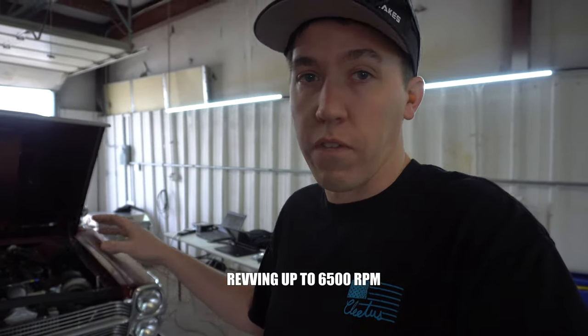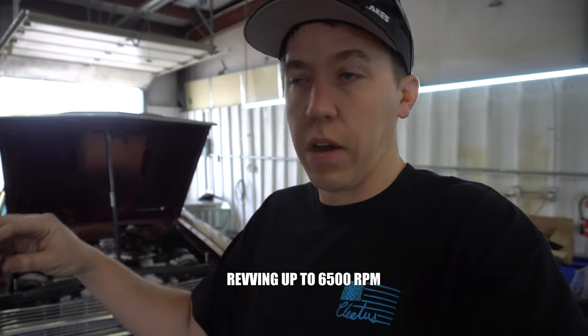They're learning what load turbo stick cars want — every car is different with converters and everything. They set the start at 3500 RPM. Now that the load is dialed in and they've seen what it can make on wastegate, they're going to start adding boost, which pushes the dyno further. It's a balancing act on a turbo car — you start at wastegate and step up. They also put in EGTs but one dropped out, and they put in a new O2 sensor due to some discrepancies.